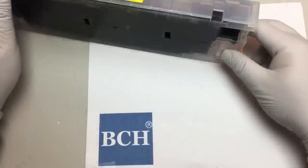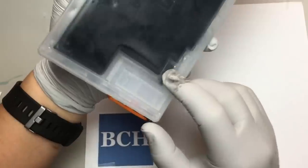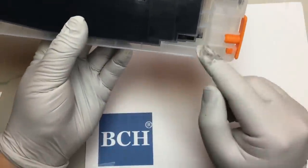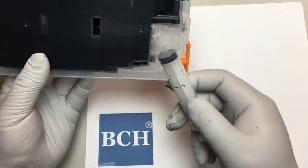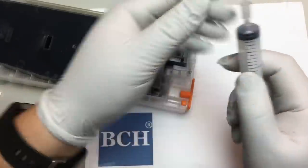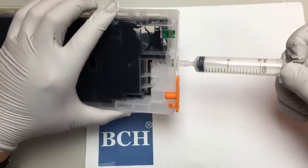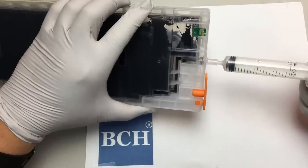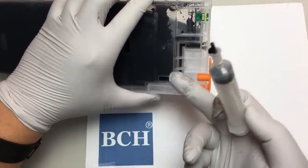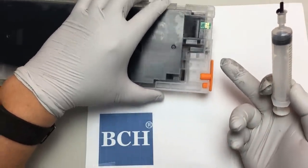The next thing is, if you see air in here — maybe it's the first time — you're going to see air. What you want to do is use the first adapter and a 10ml syringe, and draw the ink out of here. See the ink coming in? This is very important, because otherwise all that air is going to go to the printhead and possibly clog it.